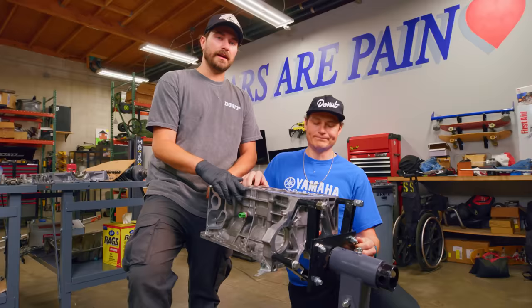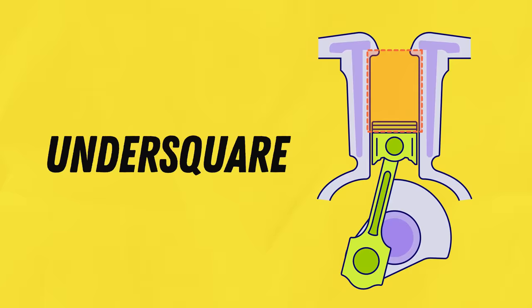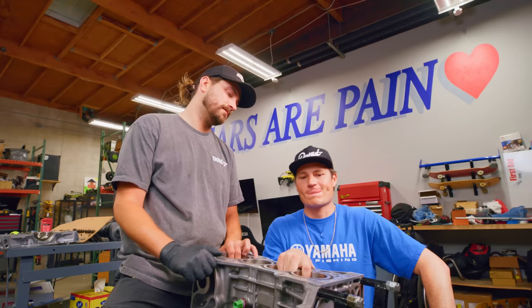This is a square engine, but there are also over-square and under-square configurations. Over-square is when the bore is larger than the stroke, which is good for making a lot of RPM. Inversely, under-square is when you've got a smaller bore and a longer stroke, which is great for making torque — and that's often the way diesels are. This K20A is kind of a happy medium between both. All you need to know is that it just revs up really high, and that's where it makes its power.